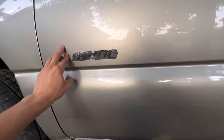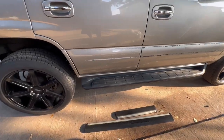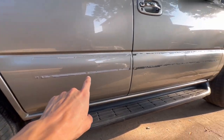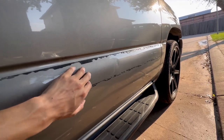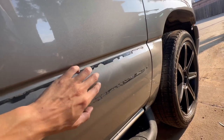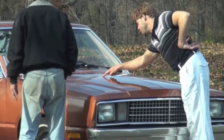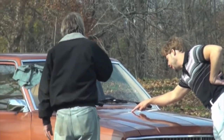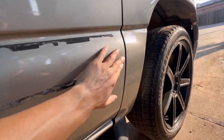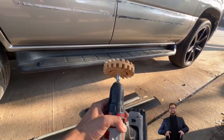If yours are real bad they might not come off as quickly. On the passenger side I already removed the moldings and now you can see the residue of the tape. Sometimes when you remove these there are different things underneath — like dents — that people cover up with moldings. And indeed there are a few more blemishes on the car: a small thing here and a couple down below, but they're not too visible and can be fixed later. So I'm going to start taking the residue off with the eraser wheel.